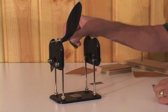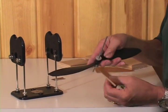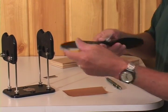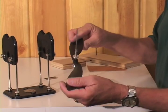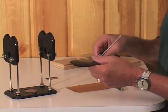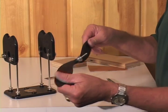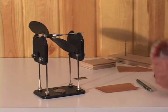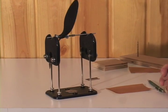Now I'll go over it with kind of a light 180-200 grit paper and just smooth out everything, so you've got the edges and the surfaces evened up. Then you get a nice finish completely. You can go over it real fine, maybe 300-400 grit, over the entire blade, front and back, and it'll look really, really good. Now you've got a balanced prop that'll work fine and eliminate vibration, which would cause all kinds of troubles.